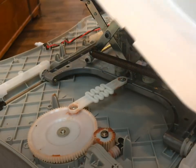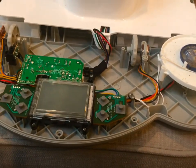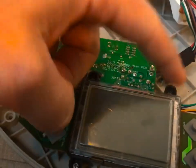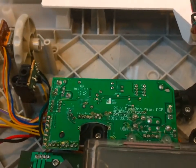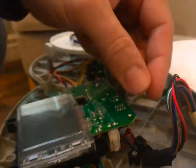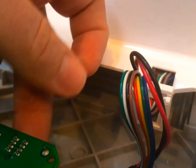So I started looking at this, and I'll get right to the point of what I found. If you pop these screws out here, there's two more up here, and there's a screw on each of your controls — that'll all pop off. There's a bracket here that holds the wires down. After playing with it for a while, I found — and I'll try to get it on the video here — there's a connector under there, and you'll see that these four wires right here, the brown, black, white, and green wire, go to a connector of their own underneath here.